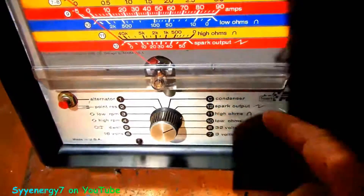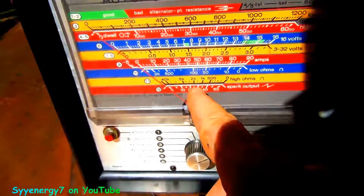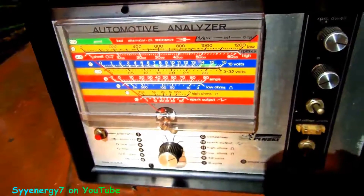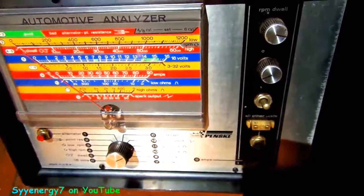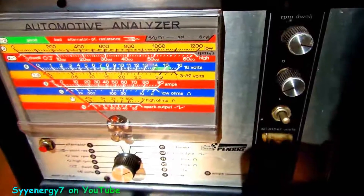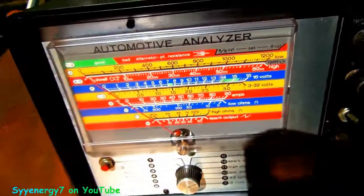The fancy stuff is this old Penske, made in USA gauge. This will tell you spark output — right here on the bottom — like if it's putting out 30,000 volts or whatever. If you got a weak spark, you might want to check your ignition wire right where the spark plug boot is — it could be corroded, or maybe where it's attached to the wire itself. Chainsaw ignition wires aren't resistive — they're just a copper core inside — so that would be another thing to check.